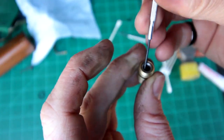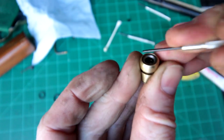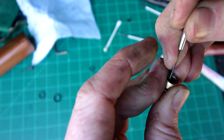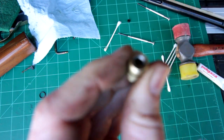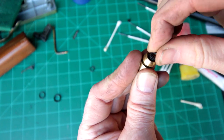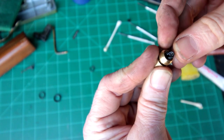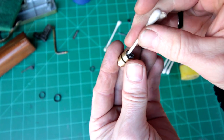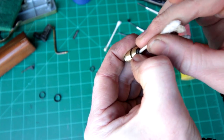It's hard to see in there, but there is a little tiny O-ring in there that you gotta get out. And then once you get it out, you gotta clean up in that groove good to make way for the new one. Right, this one you're supposed to pinch and shove it up in there. And then use a wooden object. In this instance I'm going to use a Q-tip handle to get it in there once it's all the way in.